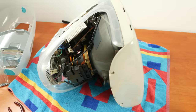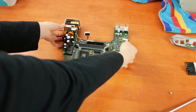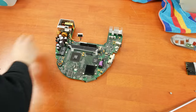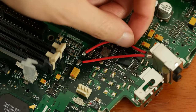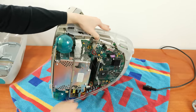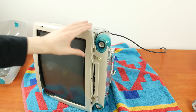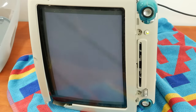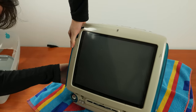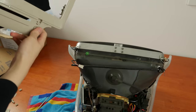Meanwhile, I'd been consulting with a friend who knows even more about these iMacs than I do. He discovered that the capacitor knocked off the board wasn't actually necessary for the board to run. This could mean the crystal oscillator was the only thing preventing it from starting up. Rather than wait for a new crystal to arrive, I realised I could botch the old one back on with wires. It looks ridiculous and certainly isn't a permanent solution, but it should at least give us an answer. I put in a non-bent stick of RAM into the undamaged socket and powered it on. Much to my amazement... it worked. I was feeling really good about this project now. If the new bezel worked out too, this could make for a complete repair and restoration. As I removed the old bezel, it just kept breaking more and more, until finally it completely fell apart.